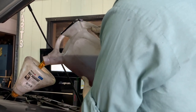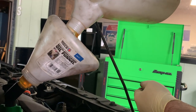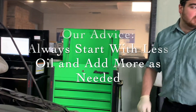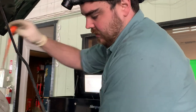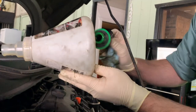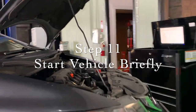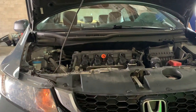Where do you find out how much oil your car needs? The service manual or Google — but whatever you find, always start with less and then check from there. Your oil filter needs to fill with oil when you start it up, so the level will actually drop on the dipstick. Put your oil cap back on — don't ever start the car without the oil cap on — and then start the car briefly and shut it down.